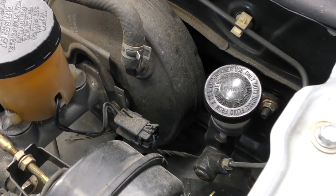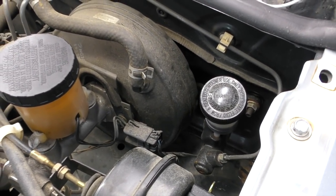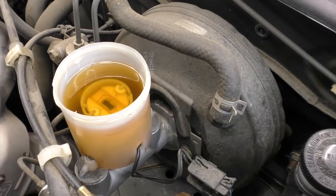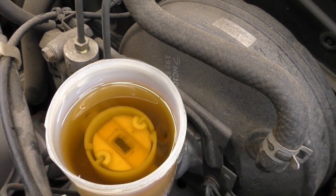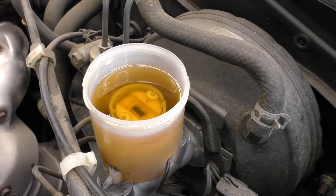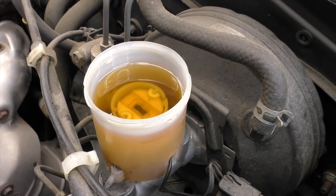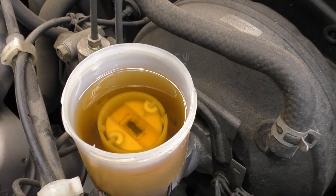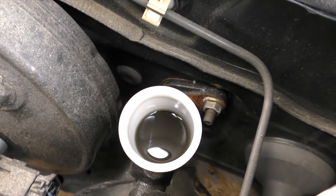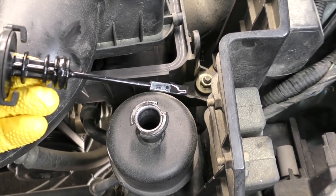Next, let's do an inspection on our brake fluid. This car is a manual transmission, so it's got clutch fluid as well — they actually use the same fluid for both but it's two separate reservoirs. A visual inspection for brake fluid is mostly looking at the color and seeing if there's any dirt or debris. This is a little bit yellow, which isn't always a bad thing. They do make test strips, but I'd rather just get fresh clean fluid in it. Moving to the clutch fluid, that's considerably darker and definitely needs to be replaced.